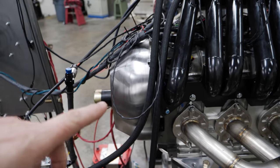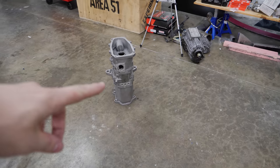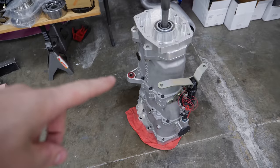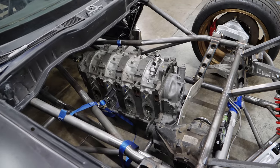I'm going to take the bell housing off of this engine and then put it onto this one. I had no luck finding a turbo 2 bell housing — I have one on the Corvette but I'm just not going to mess with it. Then I'll take the dummy transmission and put it onto there. I have to take the bushings off of this one, put it onto that one, and then we'll have that engine in the correct spot. That gets us ready to make engine mounts.